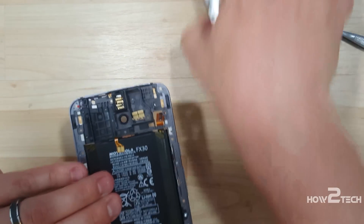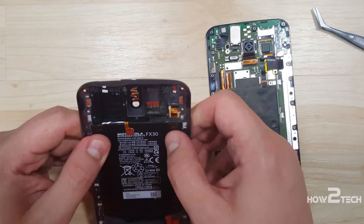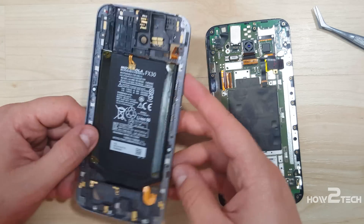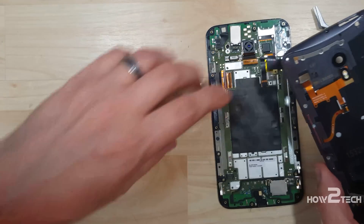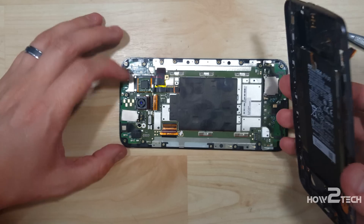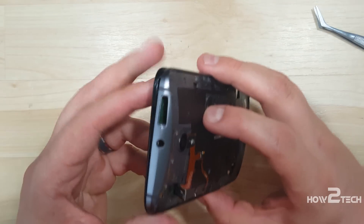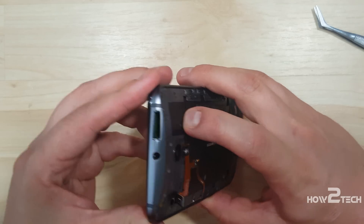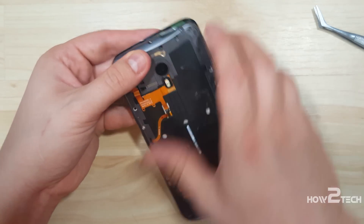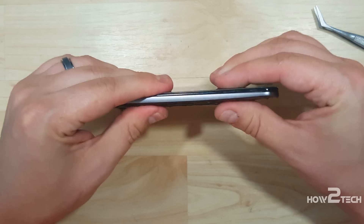It looks like everything is going to be perfect. Check the connector cut out window to make sure it's going to fit — we shouldn't have a problem. You can check it before you put all the screws in the back. Now take the back piece and slide the top portion of the phone on first. Put it over the front camera portion and try to get everything lined up on the front of the phone. It will be a little bit tricky — you may have to put it down just a little bit flatter and then work your way back.